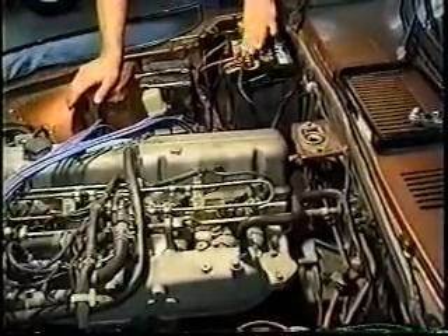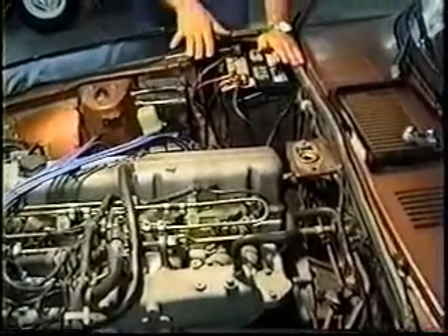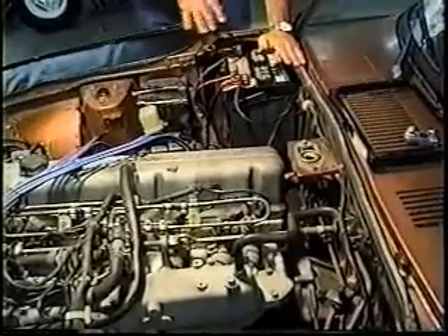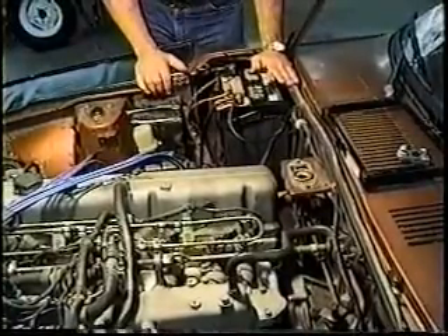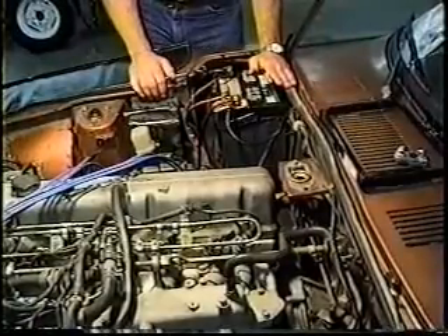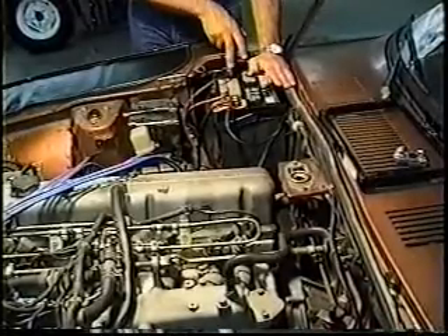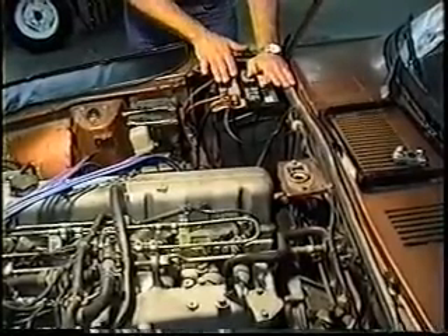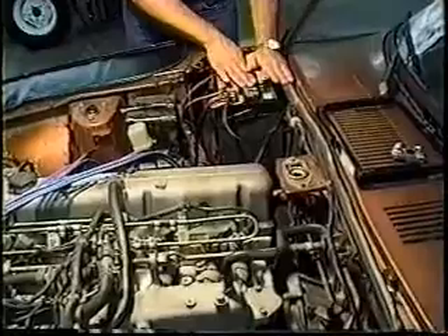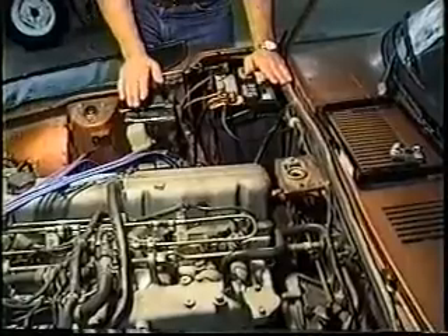Most fuel injection problems we see come in are based right here. The fuel injection connections on the ZX are integral to the original cable, and it's about $70 for that original cable. You might be dissuaded by the cost, and on top of that, most Nissan dealers don't have it in stock. Rather than wait a week to ten days to get one, this system works famously. You can get these connectors, solder on new ends, and reconnect your original two power supplies on the ZXs with a wonderful result — using the shorter battery. You will never short it out again. Put a new bracket and two J-bolts back on and you'll do famously.